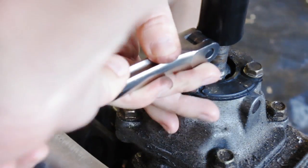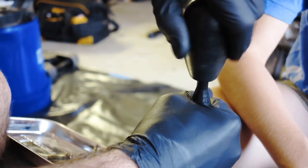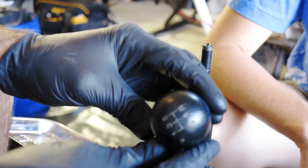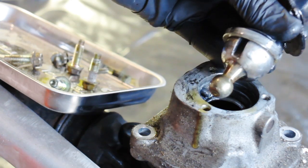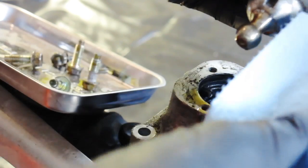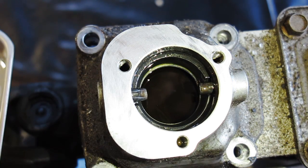So we start by taking the turret apart. As you can see, the rubber is cracked at the top there. Then we pull the old knob off. Give the knob a good pull. Give the knob a good pull, I said. And then you take off this rubber bit, and out she comes. And as you can see here, there should be a bushing on the end of that metal ball, and it's gone. And you look down into the turret, and there's nothing in there.